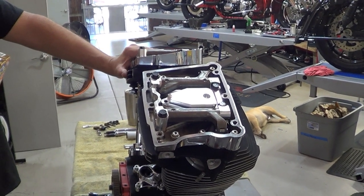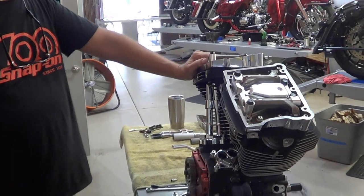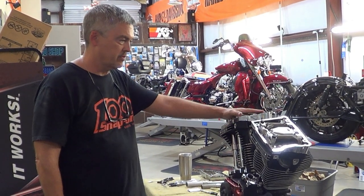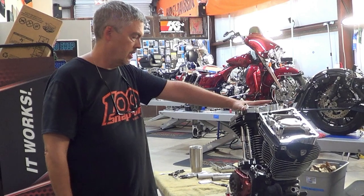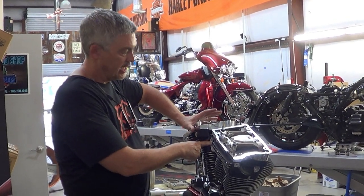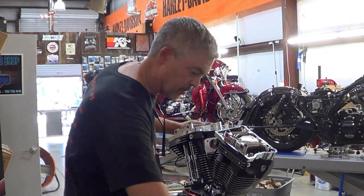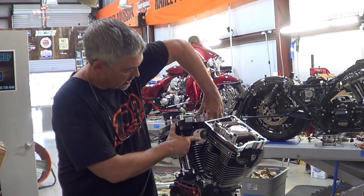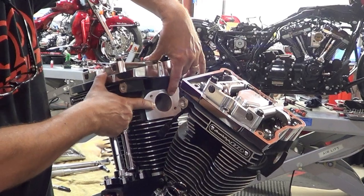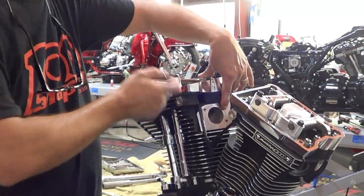So this is a pretty trick piece of hardware — this motor, hybrid for sure. It'll make a ton of power. In this case we're going to use a D&D Fat Cat exhaust. He wants mid-range and torque, but it'll make power all the way to 6500 RPM all day long. We're going to be running a Max Flow 58 millimeter high-performance throttle body — about as big as we can put on here, and they're port matched. This is an important point: these are set at 1.81. When people call in to order a throttle body, the measurement we need is the distance across the port right here. We have different port sizes on the intake plenums, both throttle-by-wire and Delphi style. You want the two pieces to match perfectly — in, through, down, and out.